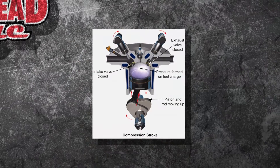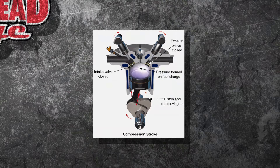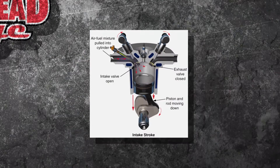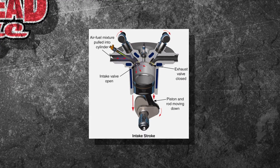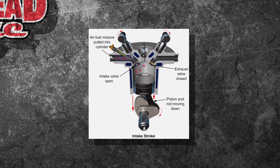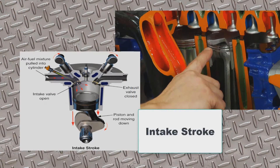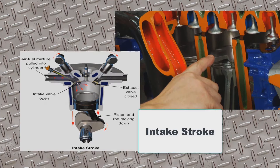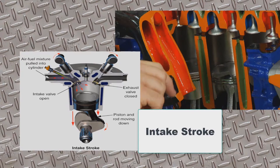We all know compression — when it goes up, it actually squeezes that mixture in there. The rings, the valves, it's all got to be able to squash in there. But opposite that, as that piston's going down — that's called the intake stroke. We're actually drawing that air-fuel mixture in and creating a vacuum. You can see it in action right here. That piston's on its way down, and when that piston's on its way down, that intake valve opens. We're creating an absence of pressure, a vacuum. That air-fuel ratio is then getting put into that cylinder.